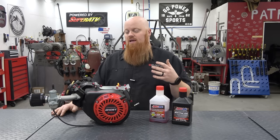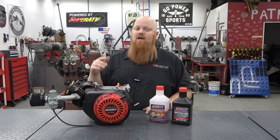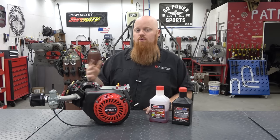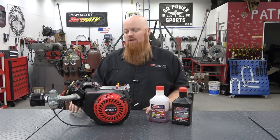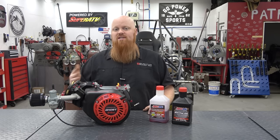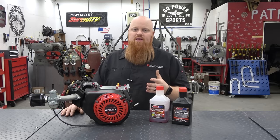I believe in my personal garage, we would go with the standard 212 because you have a non-governed coil, so you're not going to have to replace that in the future if you want to take the engine further. And you can get these carbs for pretty cheap online, and you can get valve springs for $16 for a set. So really what you're getting is a pre-built engine right out of the box.